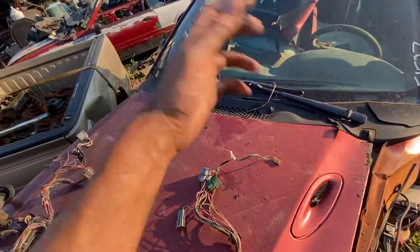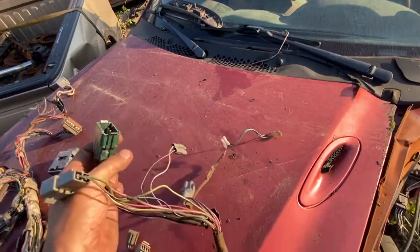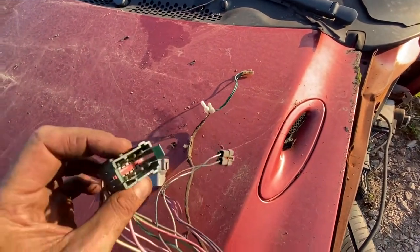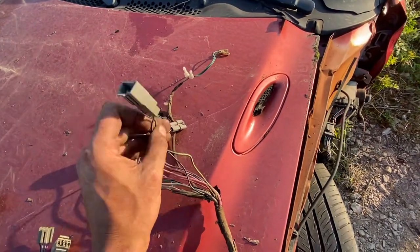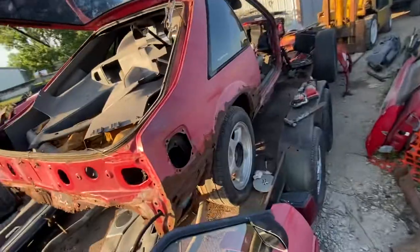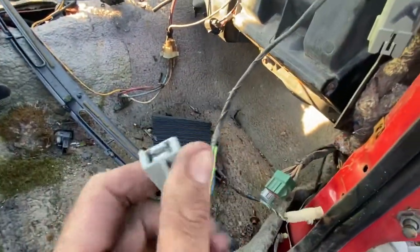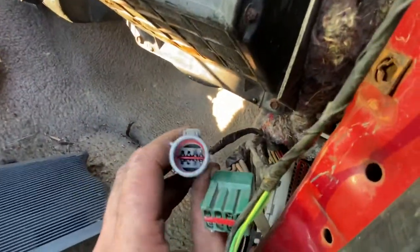Ken, on the opposite side of the car now — we're in the passenger's pillar. This meets up with some other taillight stuff over there on the right-hand side. I know this is another dash speaker wire that's been cut — this is a door speaker wire supply. This is, I think, a dome light harness — this green with the yellow tracer, I'm pretty sure that's going to be a dome light, maybe your vanity mirrors. The green one meets up with the engine harness, and so does the gray one. The floorboard's still intact somewhat, so there weren't any issues there.